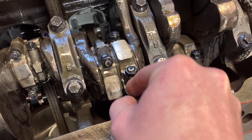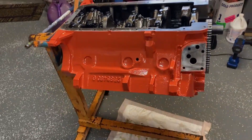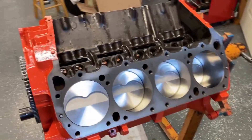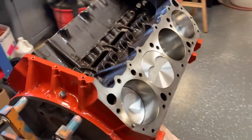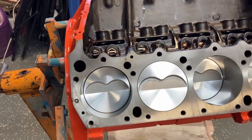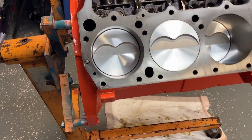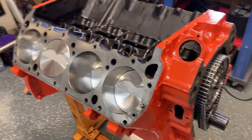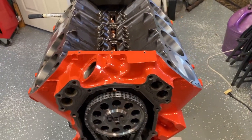They were all there, so I feel good about that. Flip it over and I can show you what it looks like top side. I'm really pleased with it so far. I did go ahead and lay my straight edge on the back side and front side to double check — we're still about five and a half thousandths below deck. So that's really nice, it's all looking good. I actually started checking my cam button — that'll be another video. Thank you all for watching, and I'll catch you next time.